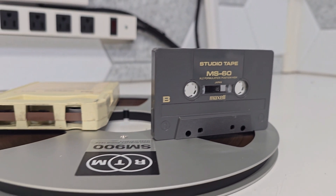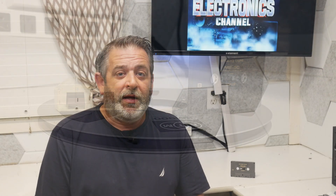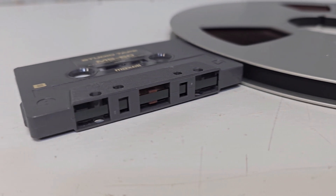This is true with cassettes, reel-to-reel, 8-track — any analog tape-based format. With reel-to-reel recording, the tape is wider than a cassette, the tracks are wider, and the tape moves much faster, making the noise less noticeable. The problem comes when you make the tape narrower, along with the tracks, and slow the tape speed way down. The slower the speed, the more noise you generally end up with. That's why Dolby noise reduction was something you saw more on cassettes than anything else.